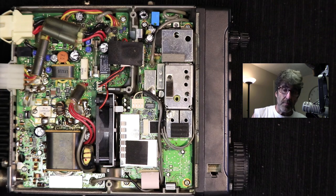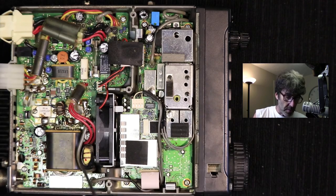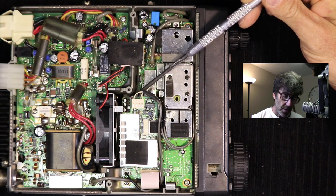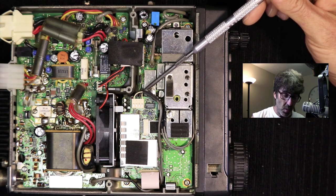What we're looking at here is the bottom of the radio. This is the VFO on this side, microphone jack, audio controls, all that stuff. This is your PA output board — power output is where your finals are at. This board here is where the problem was at. This is the PLL board right here. What happened was right here in this corner — there's a rubber pad underneath that some chemicals or something put on from the factory corroded right there.